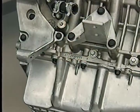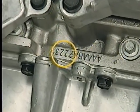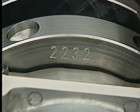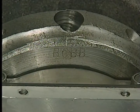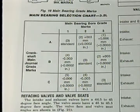To determine which main bearing inserts are used on a particular main bearing journal, you'll need to become familiar with the main bearing select fit procedure. The procedure involves using the numbers on the lower edge of the block near the oil pan mating surface, and numbers and letters on the rearmost crankshaft counterweight. Numbers ranging from one to three are used on the 2.7 liter engine, while the 3.2 and 3.5 liter engines use the letters A, B, and C. Comparing these numbers to those in the chart in the service manual enables you to determine which of five main bearing sizes is used on a particular main bearing.